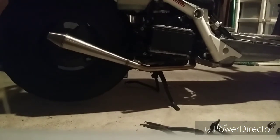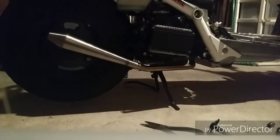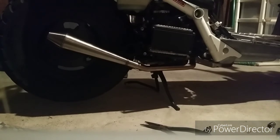This was jetted 3875 with the short intake that I run. When I ended up breaking and cutting the muffler off for this, the short intake with this 3875 actually worked. Let's see if it starts up with the 3875 jets. Then I'll take it on a quick run and let you know how it works. I doubt it'll be exactly right, but as long as it doesn't bog, I'll be happy for the next day or two.